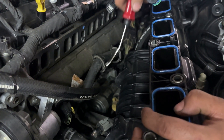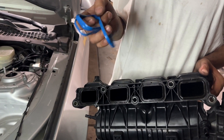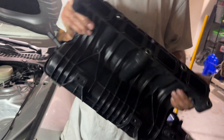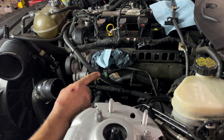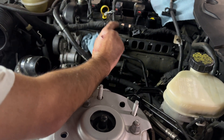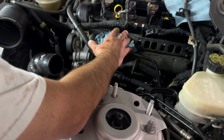Do the same to the other cord. Now that we've got those out, go ahead and pull the intake runners out. Always replace these gaskets — always. Don't say 'oh, they look good, I'll just throw them back on.' Always replace gaskets. Leave your throttle body on for now unless you have a new or different one coming. After you take out your intake runners, as a safety precaution I would suggest using tape; I'm going to use towels and shove them in every single port so that dust, dirt, or debris doesn't end up in there or in the block.